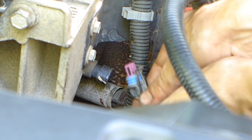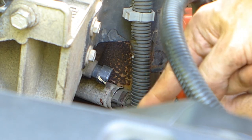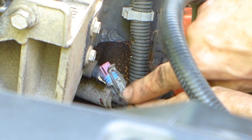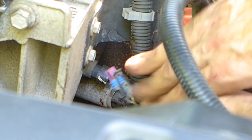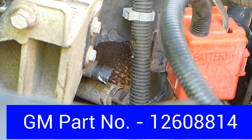The first thing you want to do is pull off the electrical plug. Start by lifting the darker gray tab that I'm pointing to right there — pull up on that and pull back. You don't want to touch the lighter gray tab because that'll loosen and remove the wires, and then you'll be in a world of trouble.